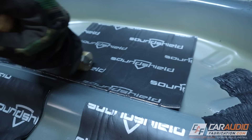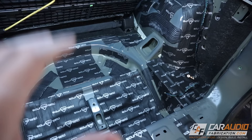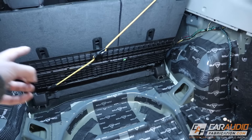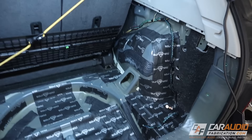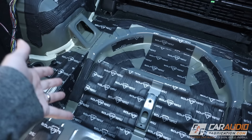Focus on the flat areas first because those are the most likely to vibrate, and then focus on areas around where your actual speaker is going to be. This is not a show car or a competition car. If you have a competition car, yes, go ahead and gut the whole interior, fully sound treat everything, cover every last inch of sheet metal. But as this is a daily driven vehicle, I wanted to focus more on getting the performance where we can while still remaining within a reasonable budget.